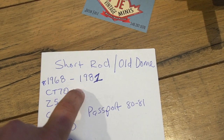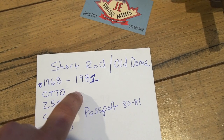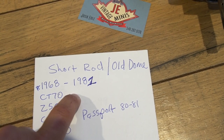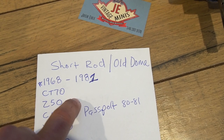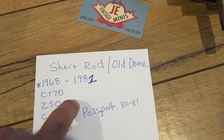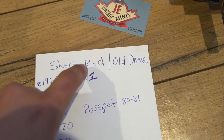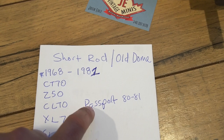My only recommendation is to rebuild what you have — your factory head. Bring it to a machine shop, have them service the head, cut new valve seats, put new valve train in. If you need to have your bore re-honed or bored and re-honed, have that done and order the correct piston that works on the short rod. I'll show you where you can find some of those items.